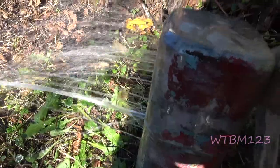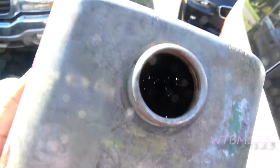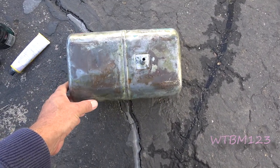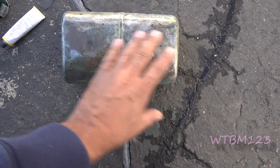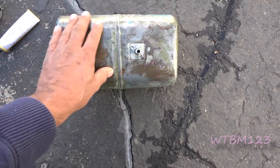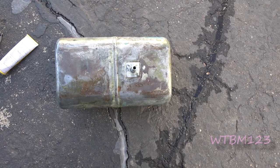I'm glad to see a lot of new leaks in the bottom — the ones where the outlet is, but the rest of them I don't think are supposed to be there. You guys probably can't see down in there. I soaked with that Evapo-Rust — it says four hours, and their website says overnight, but I was like three days into it and still didn't like the looks of the inside. So I took 50-50 muriatic acid and water, duct-taped the whole bottom up, put it in and let it set for 15-20 minutes swishing it around really good. Then I got rid of that and went back to the Evapo-Rust and it looks pretty good inside — actually looks like clean metal. So I guess that stuff does work, but if it's a really nasty tank you may have to start out with something stronger.